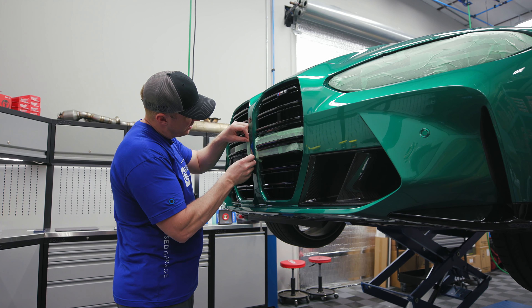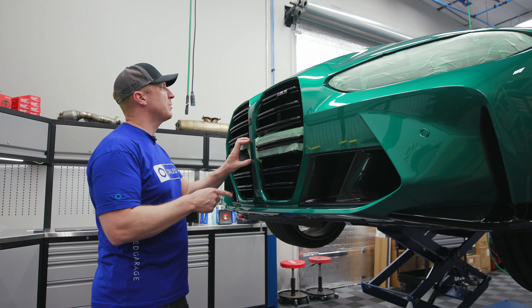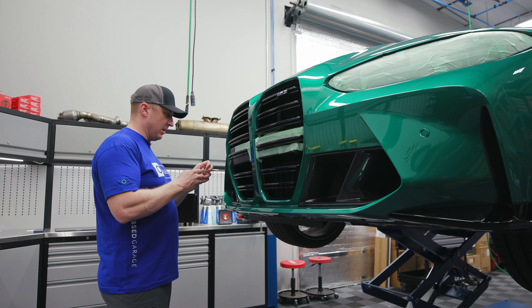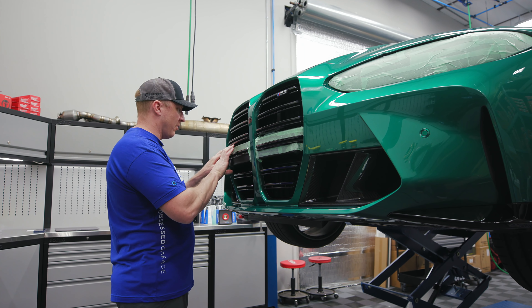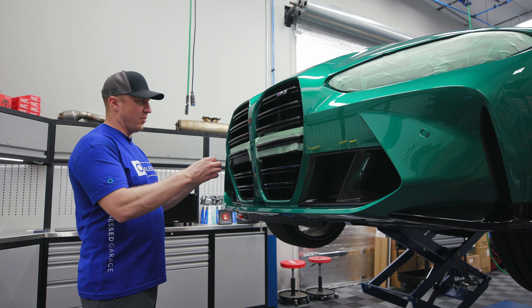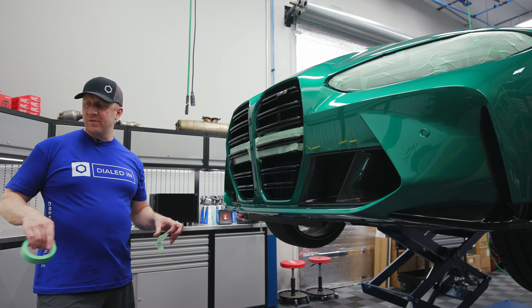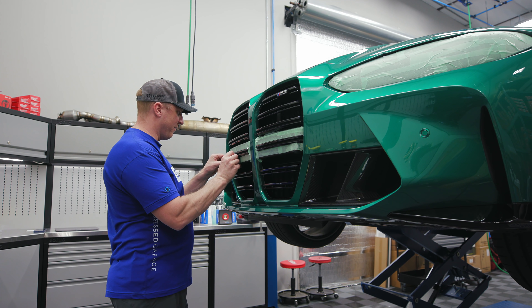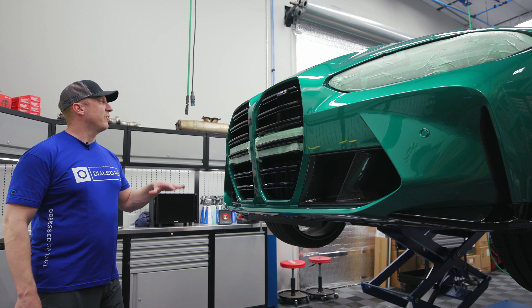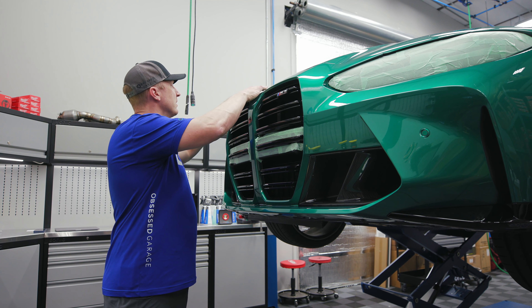The paint on this is really fantastic — probably the best paint I've ever seen on a BMW. It has the least amount of orange peel I've seen on any BMW. I think there's still orange peel, and honestly I think you want orange peel to some extent unless you're going to do some really sophisticated metal correction. The added benefit of orange peel, other than being more environmentally friendly, is that it takes your attention away from any waves or imperfections in the metal. If we wet sanded this car and got it flat, you would notice all the imperfections in the surface.